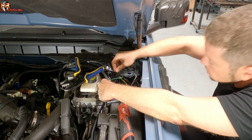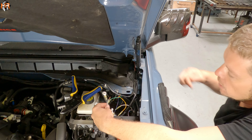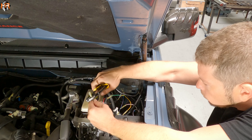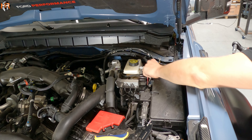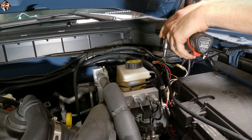For the amber DRL, that's going to be the yellow wire with an orange stripe in it, and that's going to connect to the white wire, which is the power for the DRL. Now we've got the two power sources connected. Let's go ahead and connect the ground — we already have an eyelet on here. I'm going to use this bolt here for the ground, disconnect it, thread it through the eyelet, and then re-tighten it.